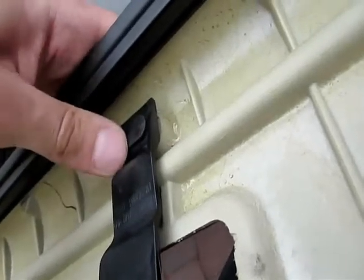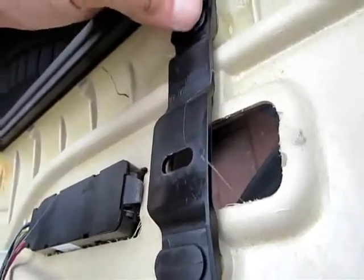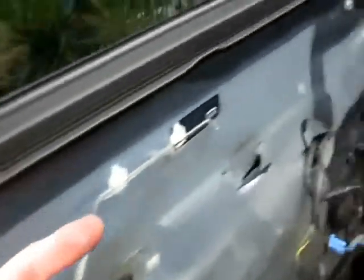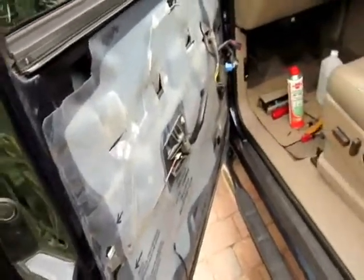We hot glued that — didn't go crazy all around it. This piece would actually come off if you wanted to — it's slotted. Much better than it was before. Seems like every time I take a door panel off it looks like it's going to rain. We're going to reposition this and retighten it — all this stuff gets loose. Lubricate all your door lock rods. This one had popped out and it sounded like crap — now it sounds mint. No more loose speaker grill and no loose door panel.